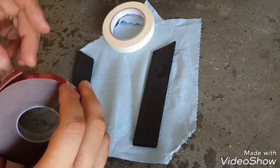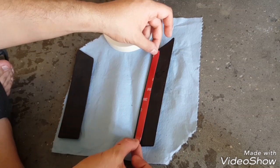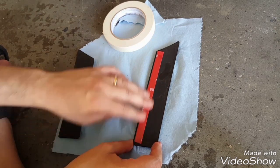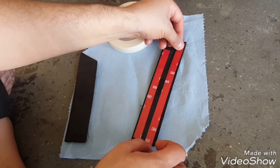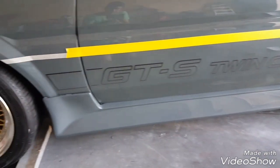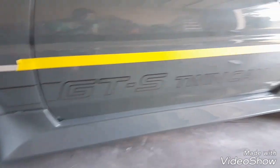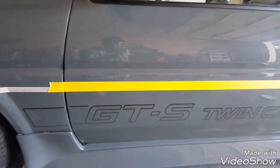One side is sticky — when you peel it off we'll go ahead and put this on the trim. I went and changed the door line because I was afraid there were some bends in it that would be hard to see with just the tape up there. But with this yellow tape it actually doesn't bend at all. I knew that this fender was good and that side was good, so if I could connect the two it should be fine. I went ahead and put the yellow tape all the way across the door so I know it's a nice straight line.